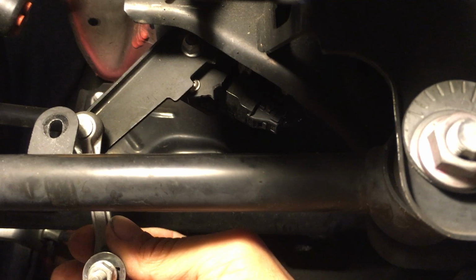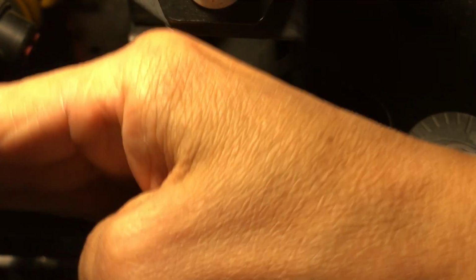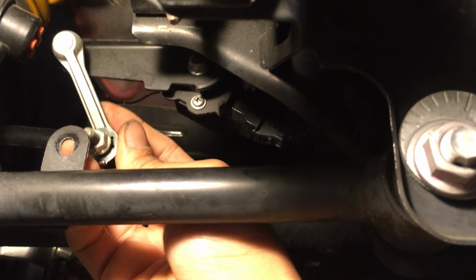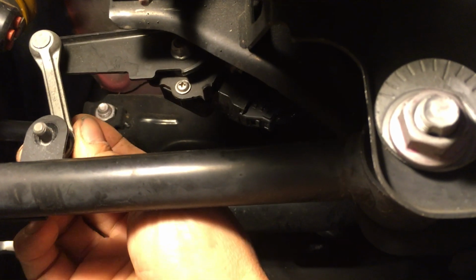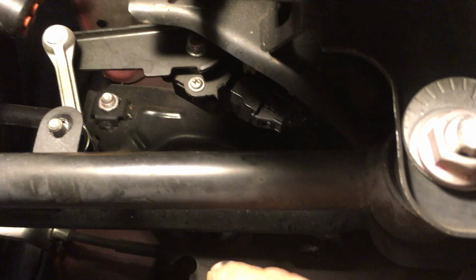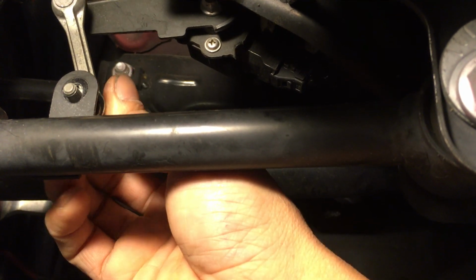Then when you put stuff in the trunk and it makes the trunk sag, that means this bar will actually raise, so this part right here will raise as well. So the car knows, oh, there's something heavy in the trunk, it's making the back end sag. If the back end sags, the front end will actually point up, so it'd be like that. Then if the headlight stays the same, the headlight will actually point higher. So this right here will compensate for that, and it keeps the headlight at the same level.